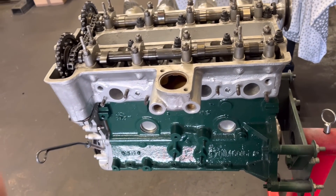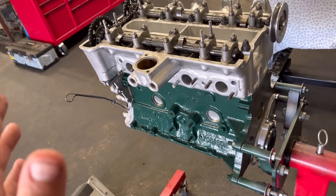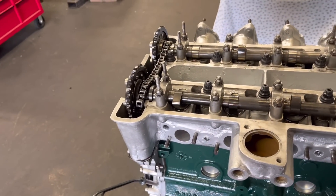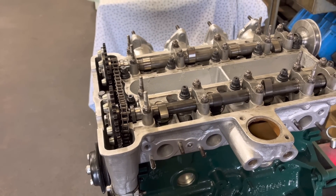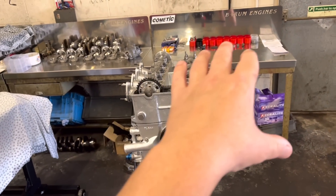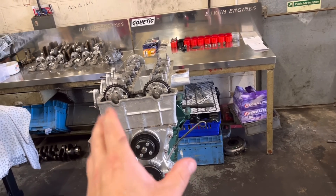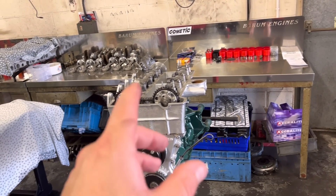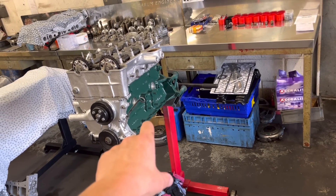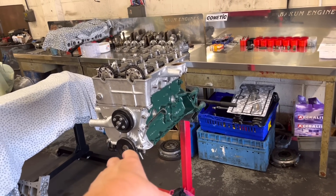The moral of the story: if that washer had been touching the camshaft it could have caused rubbing, generated swarf, and sent debris around the engine — catastrophic. Never take anything for granted. Just because it's a specific stud and nut kit for the Lotus twin cam doesn't mean it's necessarily right, especially given the base circle of this particular camshaft. My next step is to roughly set the timing and chain, then go through the normal process of setting up the verniers on the cams. After that we just need the pickup and new gauze, hopefully arriving Friday or Monday.